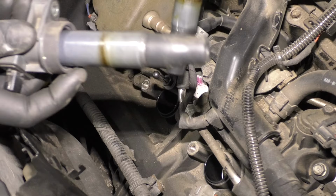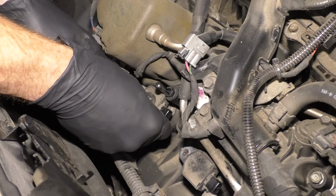All right, plug them both in, clear that engine light, take your vehicle for a ride. Hopefully the engine light stays out. More than likely it won't, it's going to come back on. When it does, see if that says that it still has this problem in the same cylinder, or maybe it moved to where you moved that coil to. If the issue moved to where you moved the coil to, you know that it was probably a problem with the coil.